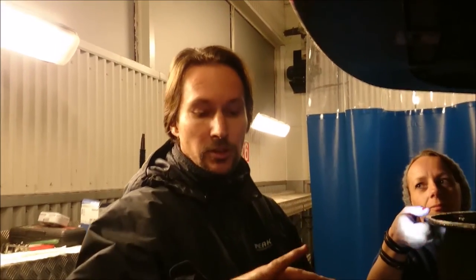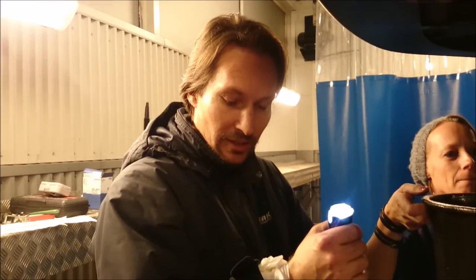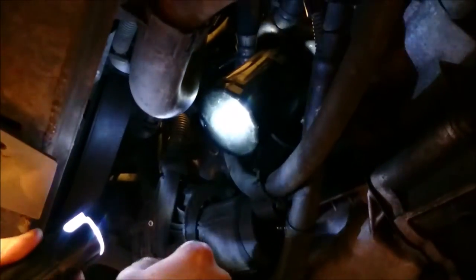Okay guys, so after some minor injuries, some blood, definitely some sweat, and some gorilla muscles, I don't know what anabolics the Volkswagen group's mechanics are on, but they have not used hand power to attach the filter. We had to literally almost bring the car down. As you can see, it's in a very tight spot. That means that you have very little leverage to use tools here. So the easiest tool to use, if you can find them, is the one with almost like a cup, and then you just drill it loose. But now, after 20 or 30 minutes of going, I can use hand power.